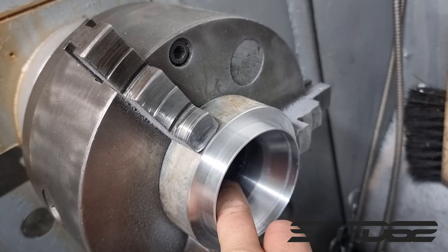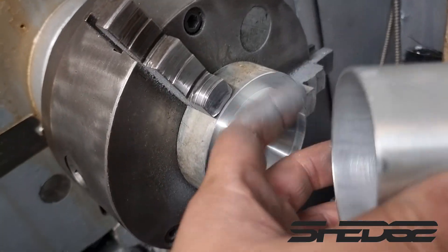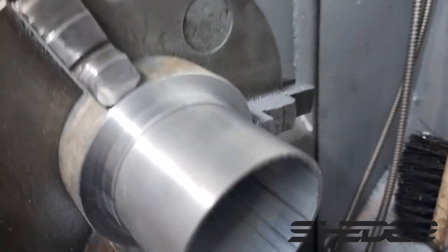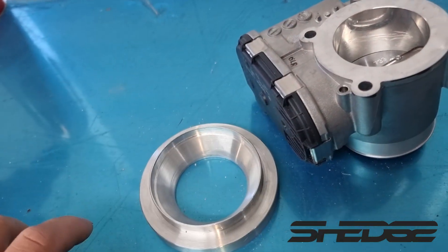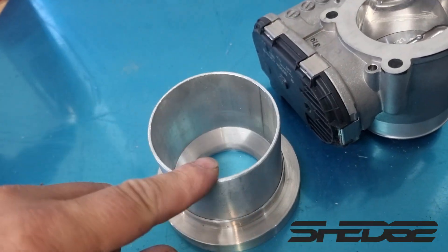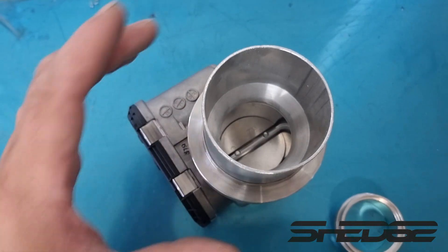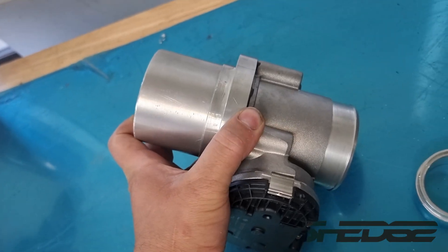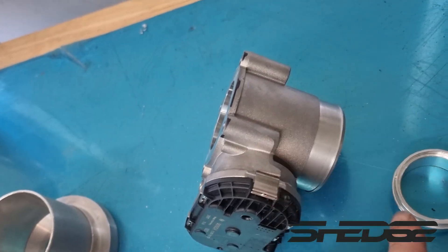Here's the weld inside of the drive-by-wire all done. As you can see we've got two different angles to make a smooth transition from the 54mm throttle body to the three-inch tube, and this lip here is the same thickness as the three-inch tube we're using for the plenum. All we have to do now is drill and tap it so we can attach it to the throttle body. With this off-cut representing the front of the plenum, you can see there's a nice smooth transition to the throttle body. This will be welded on and we'll have bolts going through there because we'll be drilling and tapping this one - that's how we're going to fix the new flange.